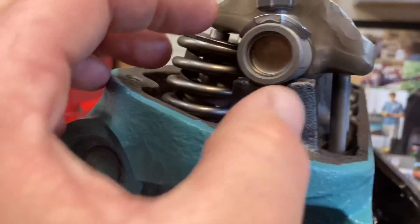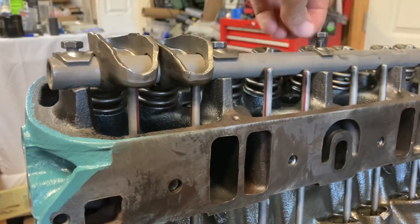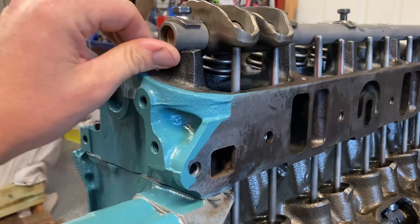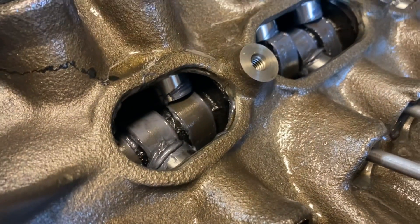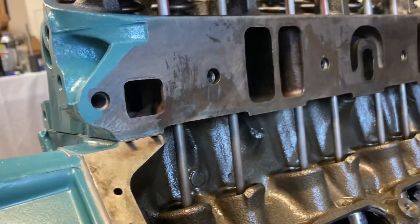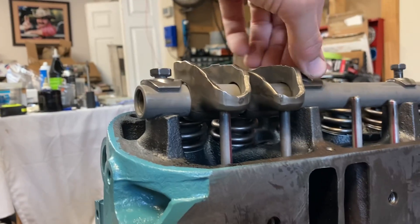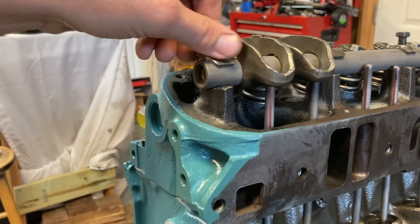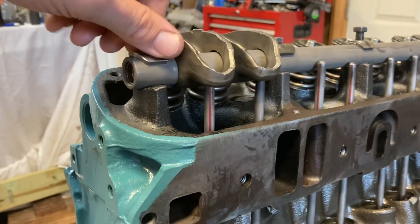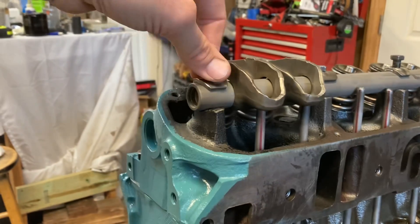What we have here is that distance. So what I'm going to do with my two bolts here — I just put three in to kind of center it up, these are loose. As I tighten this, I'm going to check this intake valve on the back side of the cam lobe, and that gives me the most distance there. I could actually pull this push rod out; it doesn't super matter right now because we're just checking that intake. But I'm going to check the intake and exhaust. So I'm just finger tightening these.